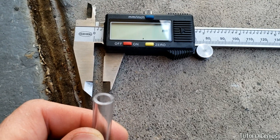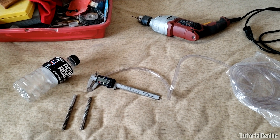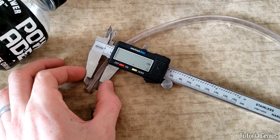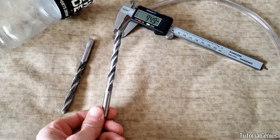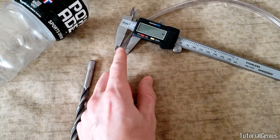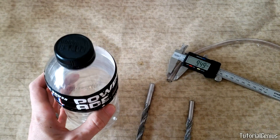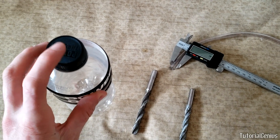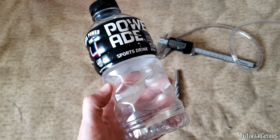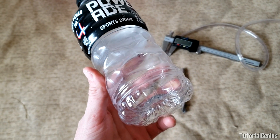Let's get back in the house and finish up this brake bleeder. Making a one-person brake bleeding kit is pretty simple. With your tubing, get some measuring calipers on it to get a rough reading, then select the appropriate drill bit — you want to go a little bit smaller than the tube itself so it has a really good seating through the lid and doesn't pop up and down. Start with a small drill bit and work your way up to the actual size, then thread your tube through. For the container, I use a Powerade bottle because they have quite wide bottoms, so there's less chance of it knocking over if it's windy or accidentally tapped.